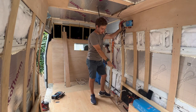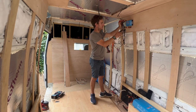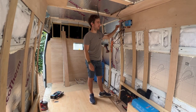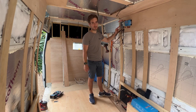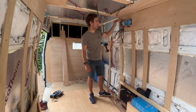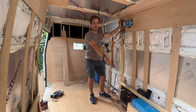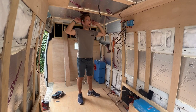This fuse box is hardly going to have any load on it, but from the bus bars at the bottom up to here I've used 10mm cable, which handles up to 70 amps. Most items in the fuse box draw only an amp or two — lights are two to three amps, a phone charger maybe two to three amps, and even the water pump won't push me over 20 amps. So 10mm cable is more than sufficient. As an additional safety measure it will also be fused down at the bottom, so if this fuse box is ever overloaded, it blows down there and ensures the wire never burns out.